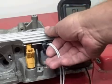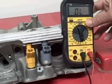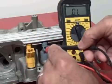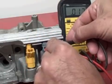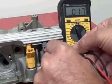Go over here to your injector, pull your wire, and take the leads of the ohm meter and put them on the two terminals. You'll get a reading — you see this one is 17. This one's in spec.